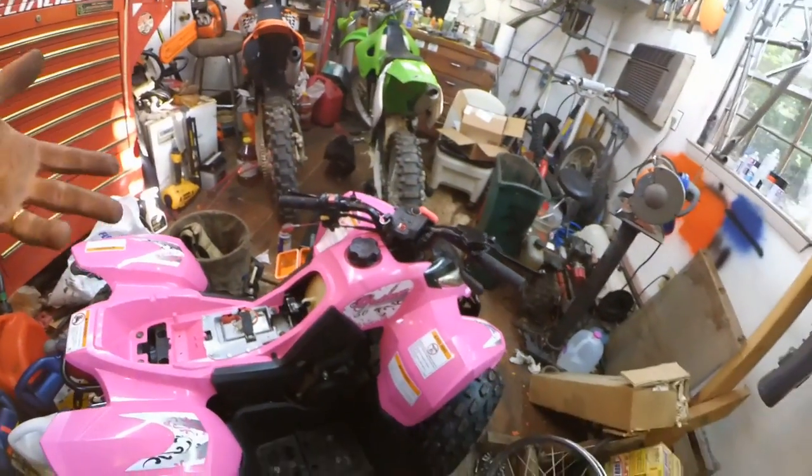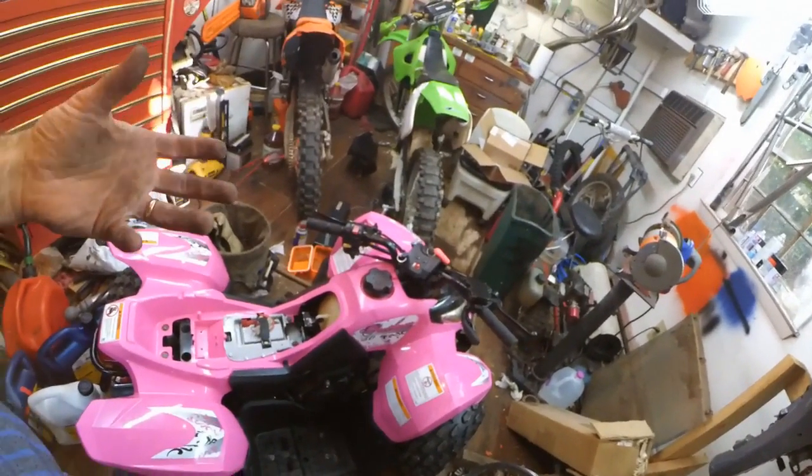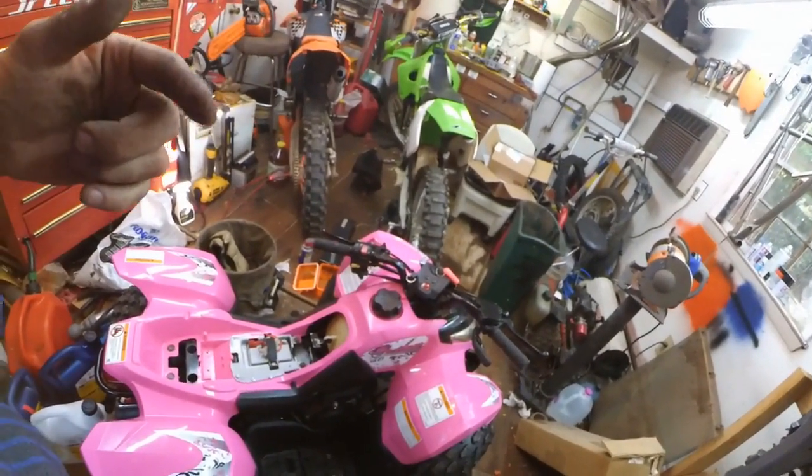That's it, so that's all there is to it. It's kind of like a clutch sprag, so those rollers in there, they just have to be clean and everything needs to be spinning easily. So when all that stuff gets bound up, the starter's trying to turn it and it's just all gunked up. So get in there, clean it all out, take it all apart.